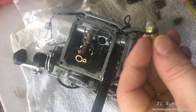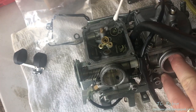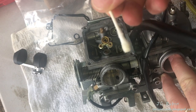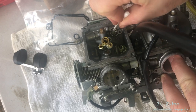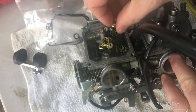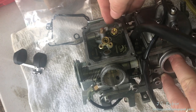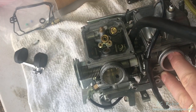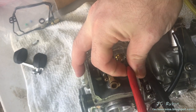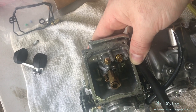Put a little bit of REM oil or lubricant on this O-ring so it's not a dry fit. Have a quick look in here — make sure there's nothing horrid. I don't see anything terrible. Everything's nice and clean. So with that, take the new seat and gently lay it right in. Put the screw back in to full seat, then give it a little snug. That's it.